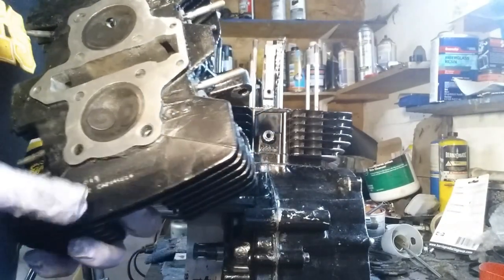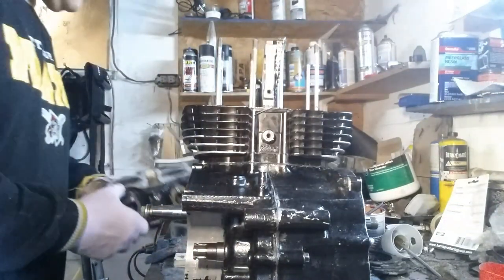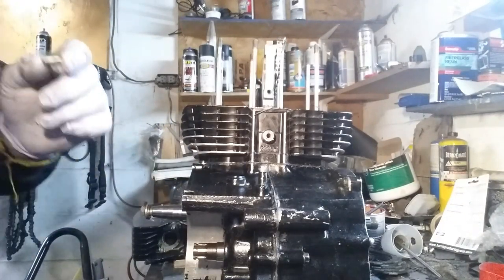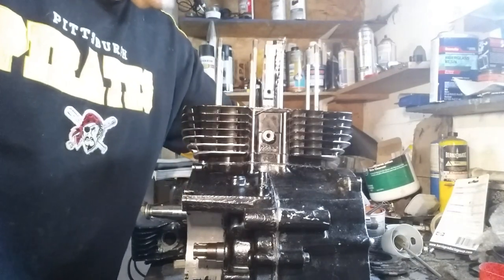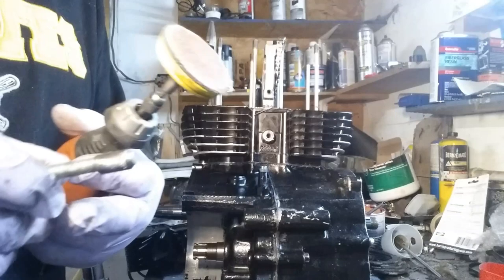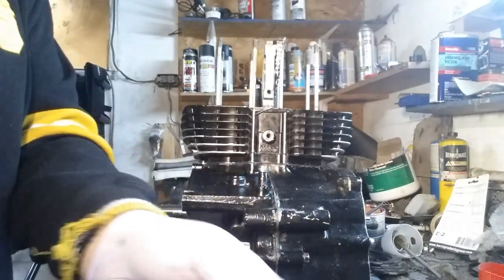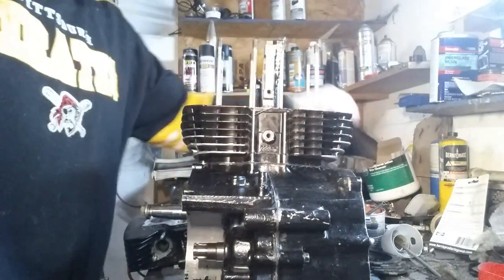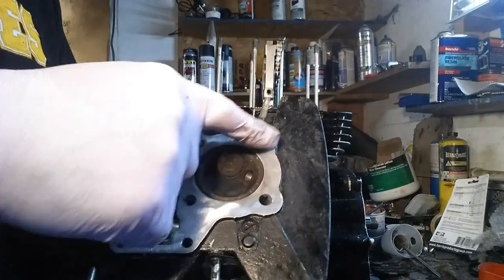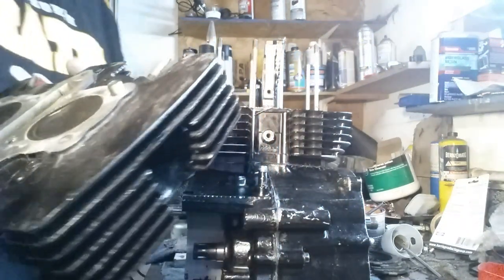What I did is I initialed and dated when I first took this engine apart, which was last year. Okay, now our dowel pins — I like to get these super smooth so they'll go in easy because I don't like forcing anything. So we're going to put these on a bolt and clean these real fast. Okay, dowel pins guys — one in each corner. These are the biggest holes and they should go in halfway, that way they go in the rest of the way inside your head and the cylinder head. This is where your tensioner bolt goes in, and the other one is here.